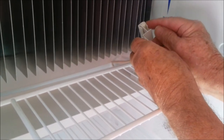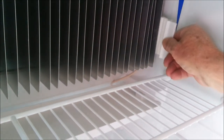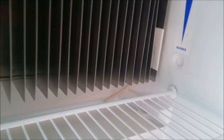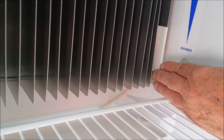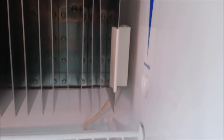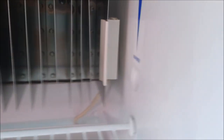You'll notice I have the thermistor — the top of it is at the top, so it should stay there. Now when I slide it in and start sliding this, the top of the thermistor will always be at the top of this, so I can judge where I need to put it. I hope that helped out a little if you're having warming issues.